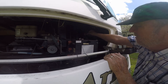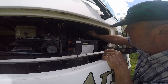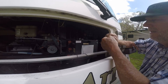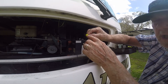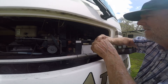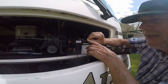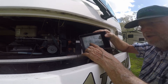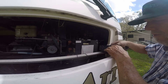Somewhere you should have a fuse puller and I have one right here. This thing will just slip right over the fuse and you squeeze and pull it like that. If you look carefully and hold this up to the light, you'll be able to see a place missing in the little metal loop in there — you can actually see that it's blown. Whenever you replace fuses, replace it with the same value that's there, and also check in here — it'll tell you what the proper value is, so if somebody changed it with a different size fuse, you always follow this, not what was in there.